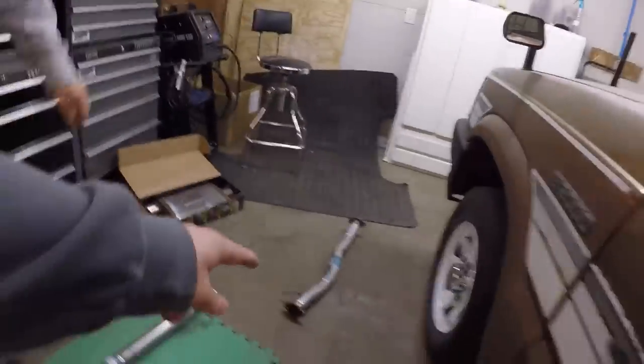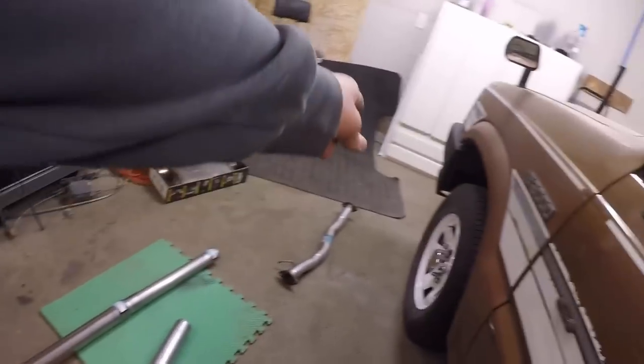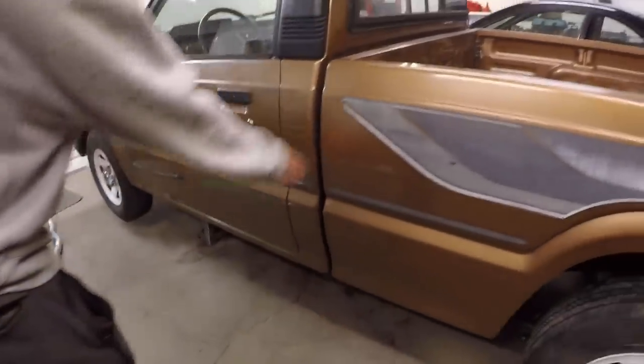I think first things first is go ahead and cut that flange off the end, then we can weld it up to this section of pipe here. We can go ahead and bolt it up just to make sure everything's straight, then see where the muffler and everything lines up. Maybe we can turn it on just to get a little exhaust clip because that's basically straight pipe at that point - it'll come out to maybe the end of the cab. Let's go ahead, cut that off, get it welded, and go from there.